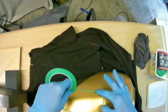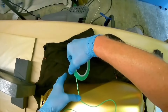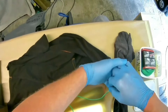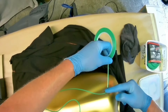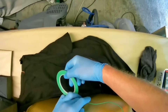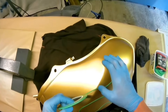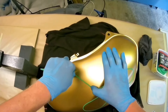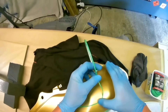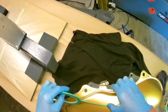Give the tape a little pull and stretch it, but don't stretch it too much — you want that line to be consistent. The left-hand side as we look at it, towards the bottom of the tank, will be the colored part. If you pull it too hard it will stretch and get slightly thinner at that point, and when you've finished that line won't look right. I'm just looking at it to get it basically right — nobody's going to look at both sides of the tank at the same time, but you want it reasonably consistent.